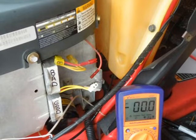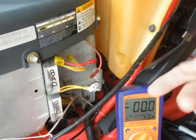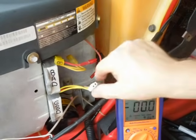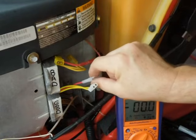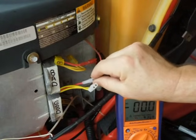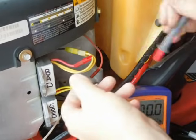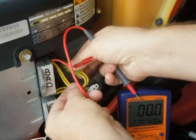With the engine revved up we're getting about 26 volts AC, so we know we've got plenty of AC voltage from the stator. Now I'll hook it up to the different regulators and show you how they behave and why you really can't — at least with my meters — fully trust the open-circuit output reading.